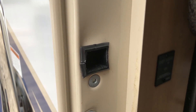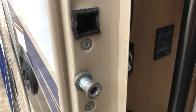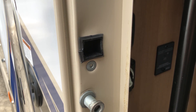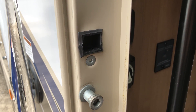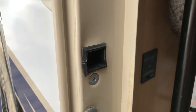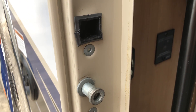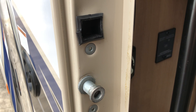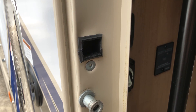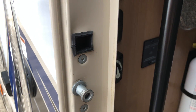Now I'm going to show you some of the things I don't like and some of the problems I'm having. Right here is one I continue to have problems with — this door. I'll set the unit up, put it up on the jacks, the door seems to latch fine, it locks fine. Give it a few hours and all of a sudden it's really really hard to shut the locks on it. I've had a couple times in the middle of the night where, even with the lock shut, the door came open on its own. The deadbolt is really hard to engage after it sets for a while.